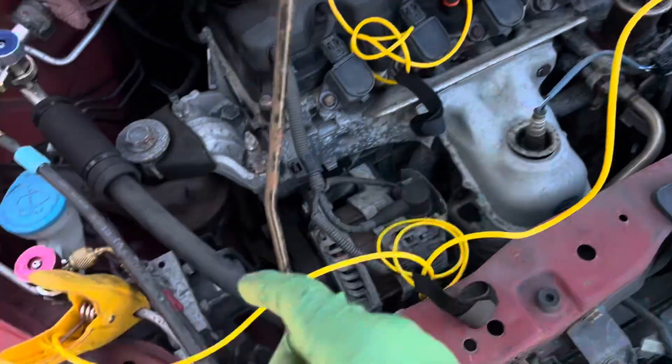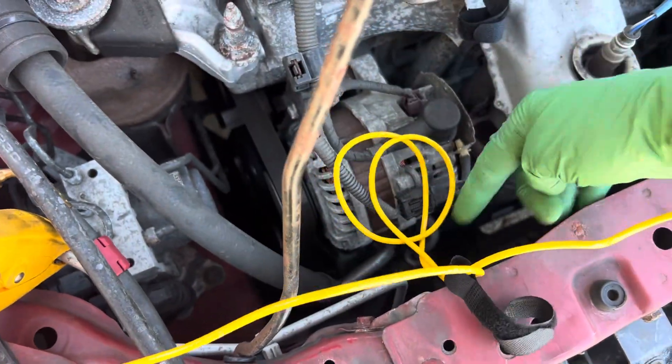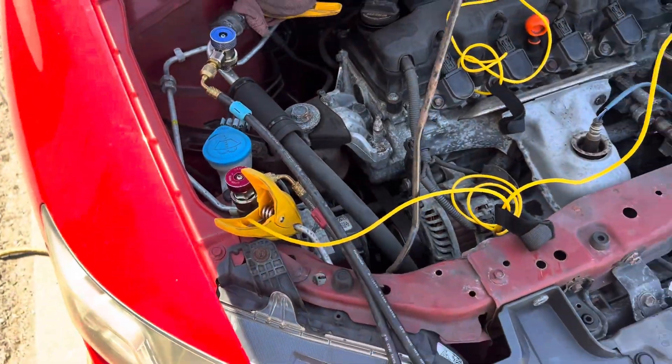It's low. I'm taking the subcooling reading right here, keeping the clamp away from that area because it'll pick up heat from the exhaust and radiator and it'll cook the clamp.